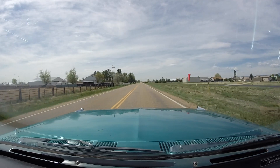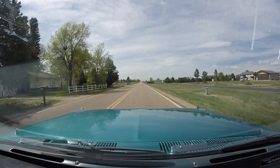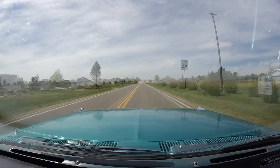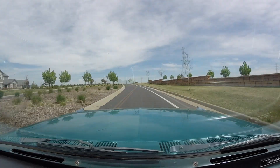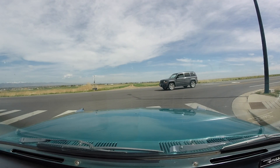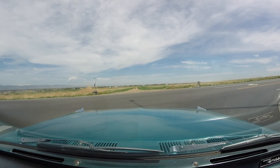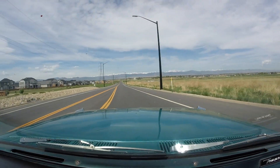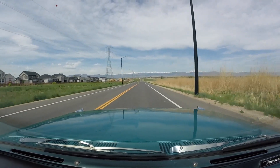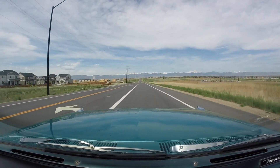And so it goes — the boring adjustment of the idle and intermediate circuit. But it's where you spend a lot of your time driving, so it's really important to have your car run right at 2,000 RPMs and lower. It sounds a lot more civilized now. It's just warming up, got a little more heat in it. Unfortunately the GoPro mount's got a little vibration in it too — I'll get that fixed, and then we'll get out on the bigger road and get into the secondaries a little bit.